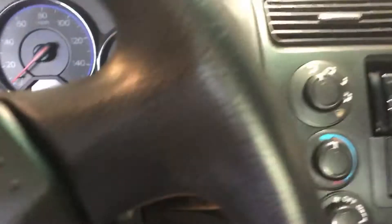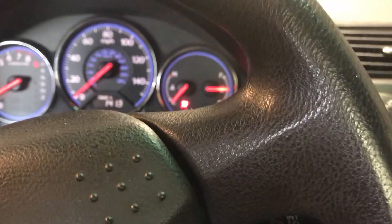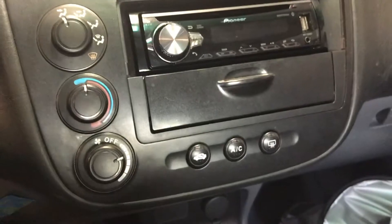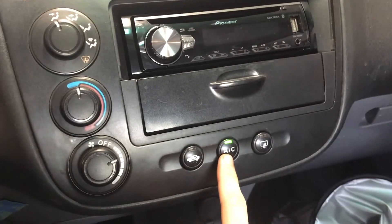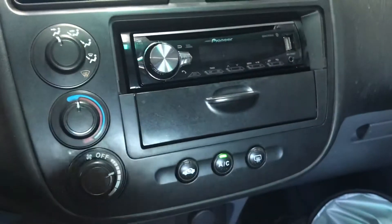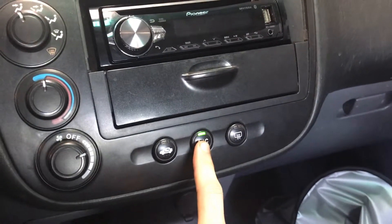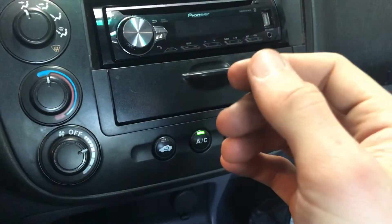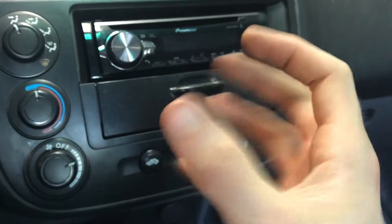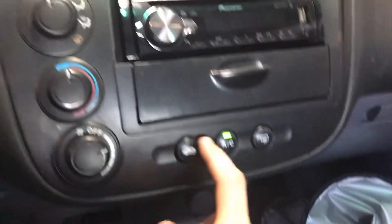Just go back in the car, turn it on, and make sure you can turn on your AC. That's blowing cold air — obviously you want your AC to be working. Last time it was making a terrible squealing noise because the belt didn't have enough tension. It was jittering on the pulley, which made a very high-pitched noise.